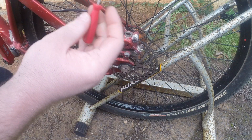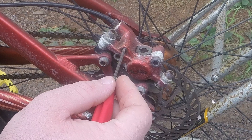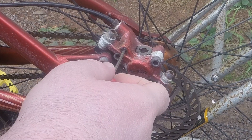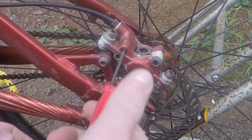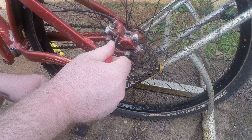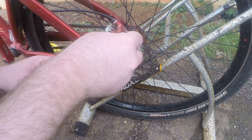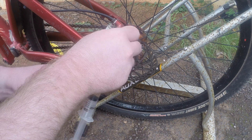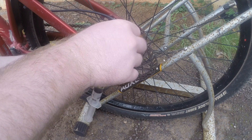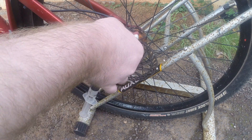Alright, so then we head down to the rear caliper. One thing to make sure: your bleeder screw is going to need a small T10 bit. First thing, you want to make sure you can crack both bleeder screws open — I checked the front one already and it was pretty stuck. So get your filled syringe ready to go. Loosen this little bleeder screw here — make sure you do not lose it — and then we're going to thread our syringe on there, just like so. Make sure you keep it clamped — do not open that yet.